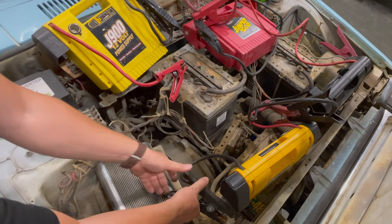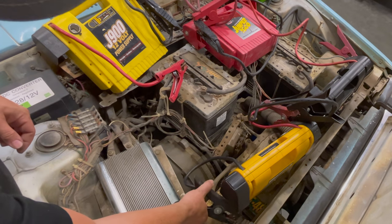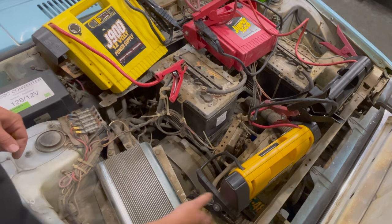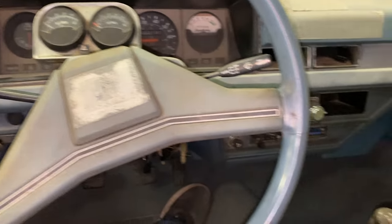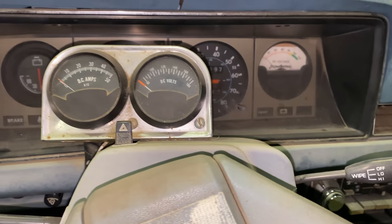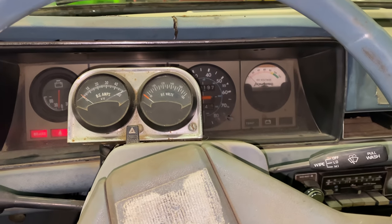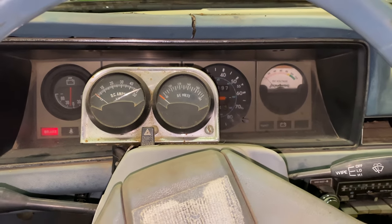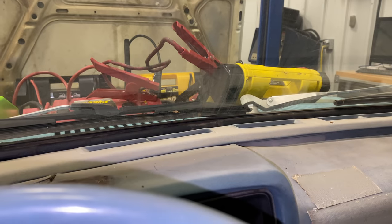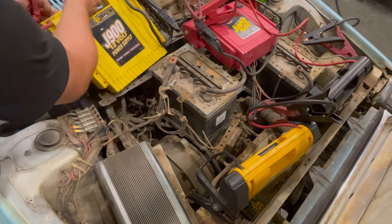Connected the last one — no sparks, which was a little scary. The good news is this car still has a manual transmission, so I can leave it in neutral. I don't have any fear that the car is actually going to move, but we can test the motor. Let's turn it on and hit the throttle. Nothing — but wait, we've got some smoke coming out up there. Not sure where that smoke was coming from, but it definitely smelled electrical.